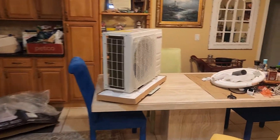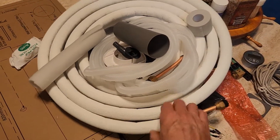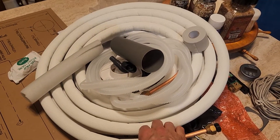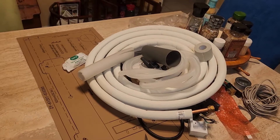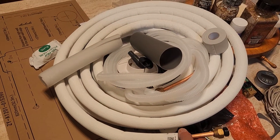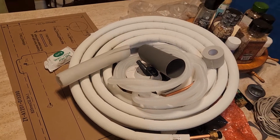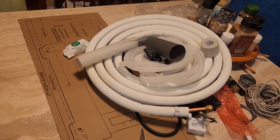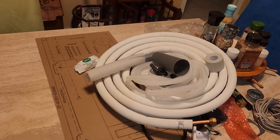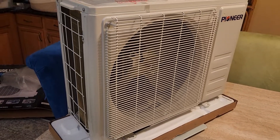At this point I don't know which lines I'm going to use, but I have to use either one of these or a combination — otherwise I won't be able to open and close the rear door. The copper line that comes with the unit is not flexible; it's bendable but not flexible. Bendable means you can bend it into a shape intended to be bent once and left alone. Flexible means it can flex back and forth as the door opens and closes. Comments are very welcome.